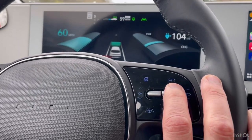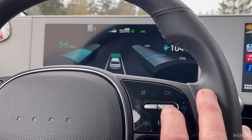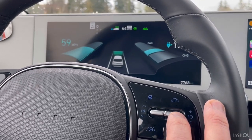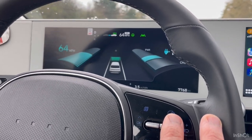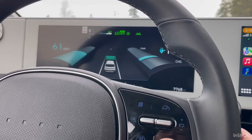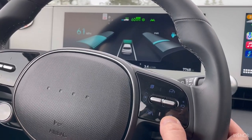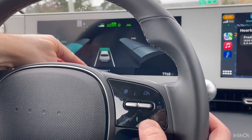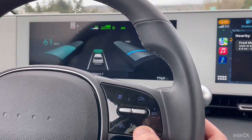I was able to adjust the speed — I could set it down to 55 if I wanted. You can go up to 65 too. But if you do that, when you hit 70 miles per hour on the north side of town, it's not going to change — it's just going to stay on the set speed. But if you come down to here, it'll follow the speed limit. This button here is for changing the following gap between you and other cars — distance 1, 2, 3, and 4.